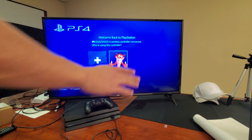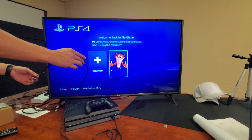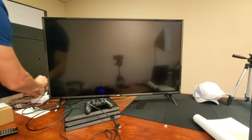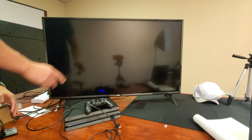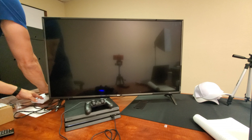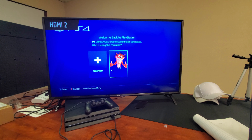If this didn't work and you're still getting weak or no signal, here's the next step: with everything plugged in and you see no signal on the TV, go to the back of your TV and pull the HDMI plug that's connected to the PS4 — pop that out. Next, unplug only the TV. So the TV is unplugged, but the PS4 is still plugged in. Wait one minute. After one minute, plug the HDMI cable back into the TV first, then plug your TV back in, and power on the TV — you should be up and running.